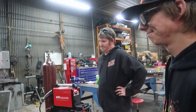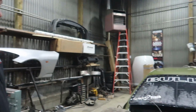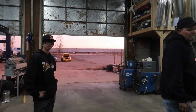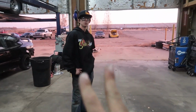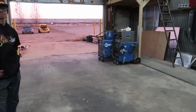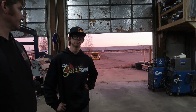Huge. We have engines that run, we have a transmission that works, and a spare. Yeah, we got a diff. We have a wiring harness that we know works. We have an ECU coming. The things that we are missing are fuel pump, regulator, so fuel system stuff. Fuel cell, that's on your list. We have one if you wanted to mod what we have. I would like a mechanical pump, but if we don't have time to do all that, we could use that in the meantime.